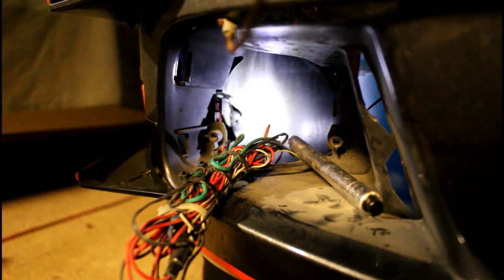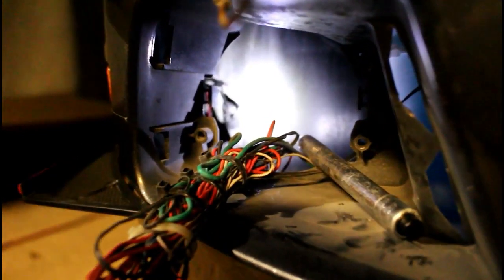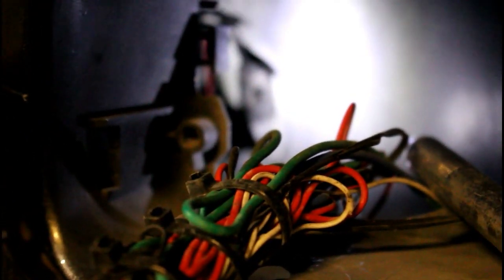I installed my lights to come on when the parking lights are on and when I press the unlock button on my remote by connecting them to the Mustang side lights in the front of the vehicle. The negative and positive terminals can easily be found by using a multimeter. And here's a close-up of where I tap into the side light wiring. And that's how I connected them.